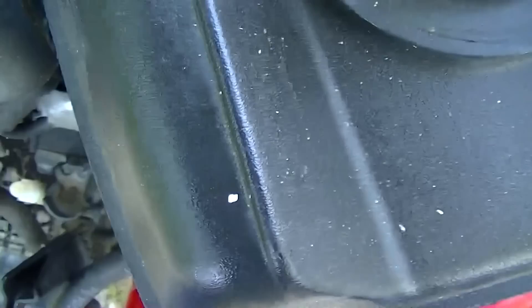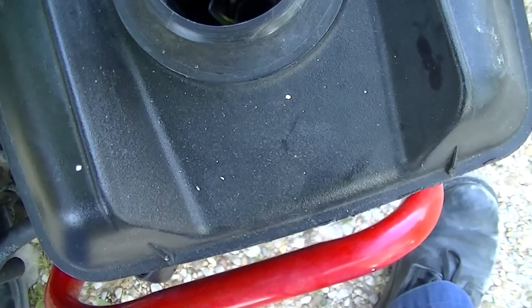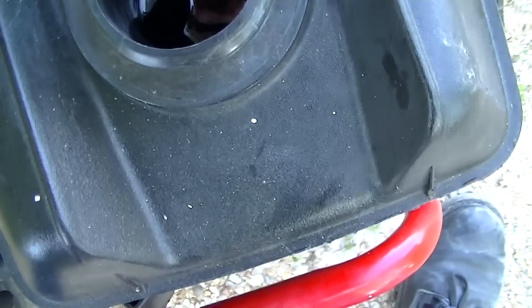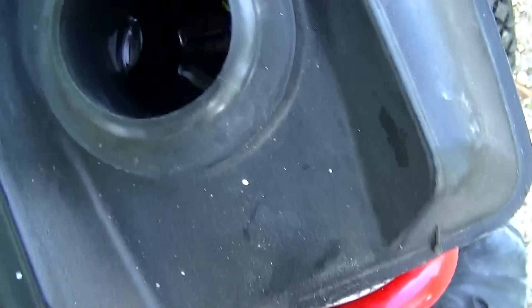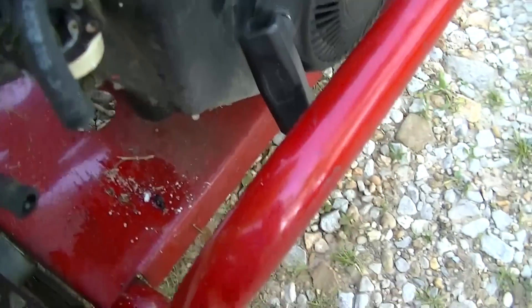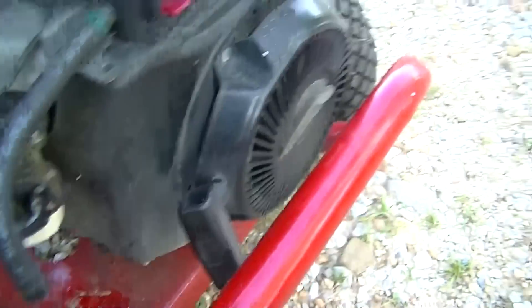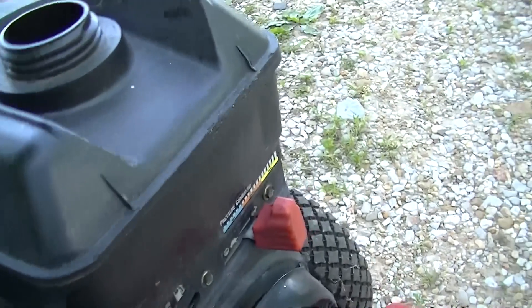So the gasoline wouldn't even get into the carburetor, and there's still a little bit I've got to get out. Put some fresh gasoline in and it will probably run. The carburetor is all clean anyway. I'll inspect it — it's dated May 4th, 2004 and it's in good shape. The float doesn't seem stuck or anything, so we should be in okay shape.